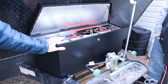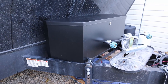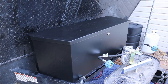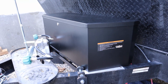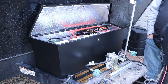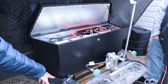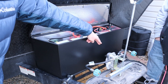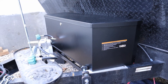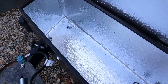Here's a closer look at the battery box, sitting right on the tongue. Rod chose this specific box because he needed something large enough to hold two batteries — which are significantly larger than the old ones — and also to bring the electronics inside. He mounted it to the A-frame with a wood base where the original battery box sat, using through-bolts going all the way to the bottom of the box.